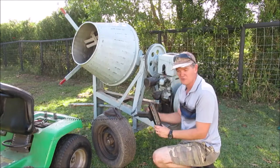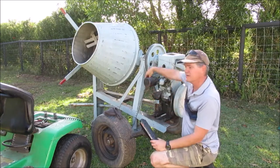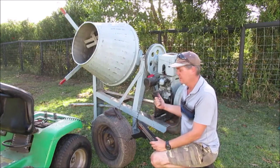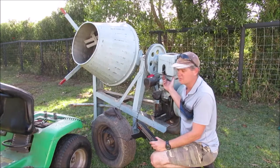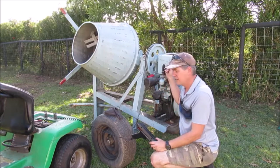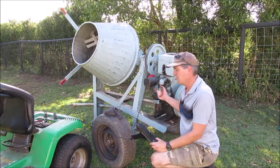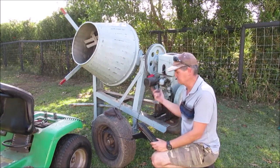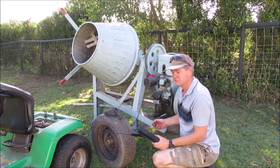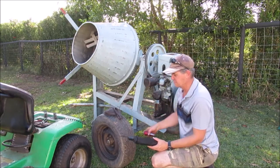Just to explain what I was doing there — I brought the rod out because I had a 12-volt battery. I was using the timing light because it's got an induction connection over the spark plug lead, and I just wanted to make sure it was getting power to the spark plug. It's a pretty well brand-new spark plug. I was pretty certain I could hear it sparking but couldn't quite see it, so I wanted to be sure. This test did verify that spark was definitely getting to the spark plug. Using a timing light is a good way to check — I've done it on other vehicles when fault finding. Simple and easy if you have one.